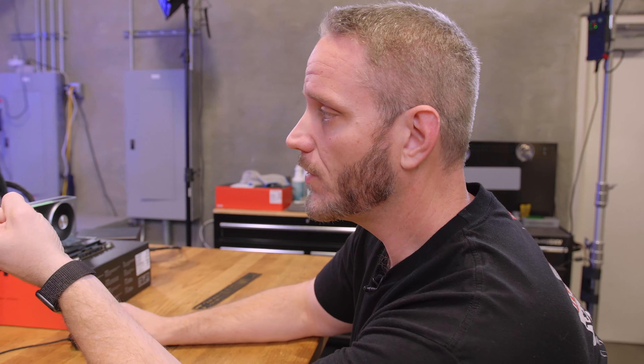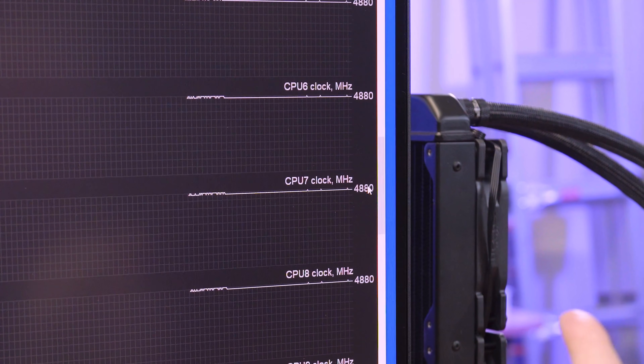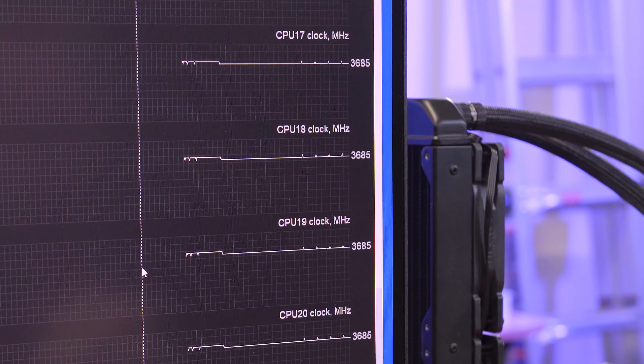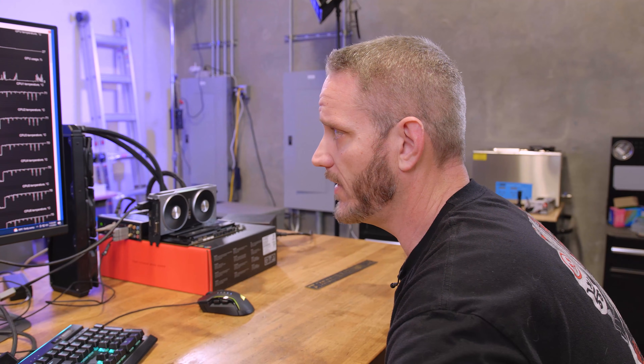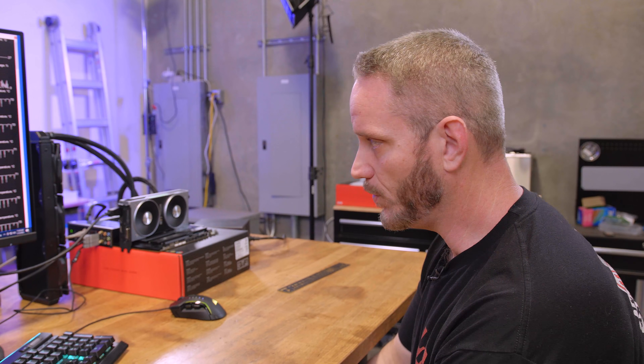I'm still going to go through with the washer test to see if we see any sort of temperature change. I did actually enable the Asus enhancements, not the core clocks. If we look at core clocks, we're running at 4.9 GHz, locked speeds, nothing changing. Our E cores are down to 3.685 GHz, so 3.7. No throttling, no fluctuating, no issues whatsoever. We'll let it go for another 5 to 10 minutes to make sure temperatures are not going to continue to climb, and then we'll show you the mod that Igor's lab and BuildZoid were talking about.